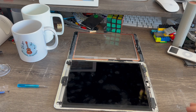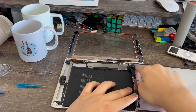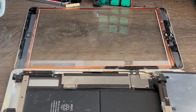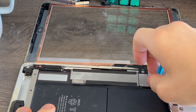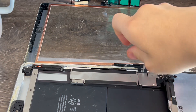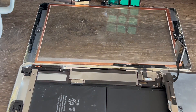I successfully got everything fully repositioned. Once you get the screws off the corners, you'll gently pry up on this bracket and set it down like this — see, this cable goes right around here, which is totally normal. Now I need to release the screws holding in the shield. There are three screws on the shield: one here, two here, and three there. My one screw fell out during a battery check so I don't need to worry about that one. You've got to be very careful not to puncture the battery — that is the most important part. The shield will come off with the connector just like that, and there's the LCD.